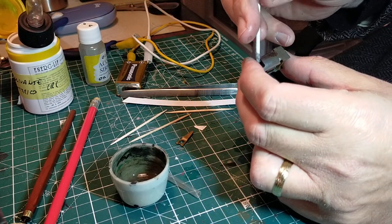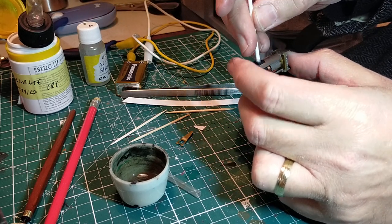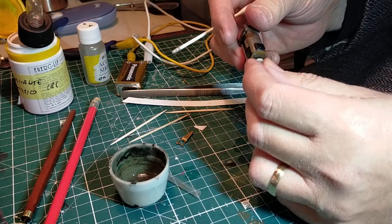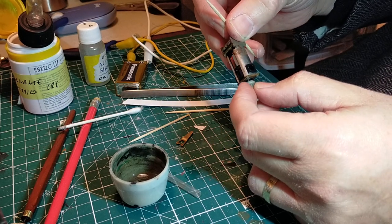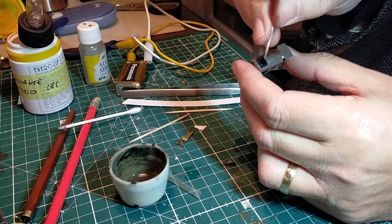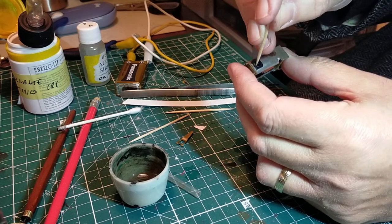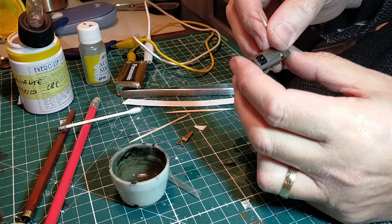So we'll go here. I'm just rubbing this wet cardboard stick with a spot of cotton wool on it. But the cotton wool's so wet that it's not going to come out. Okay. I'm checking for strands of cotton wool in there, but I don't see any. I'm going in with a toothpick to clean, sort of feeling the segments. I want to clean the segments. There doesn't seem to be any dirt.